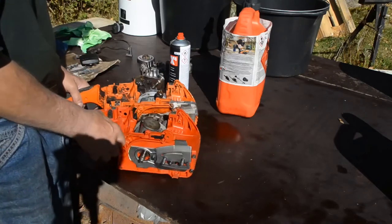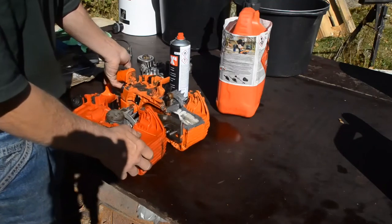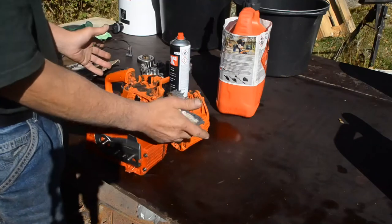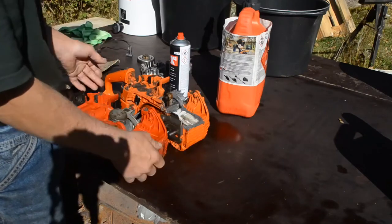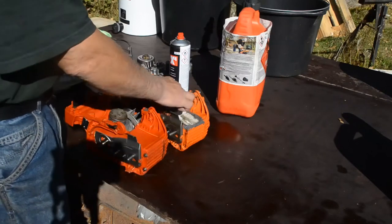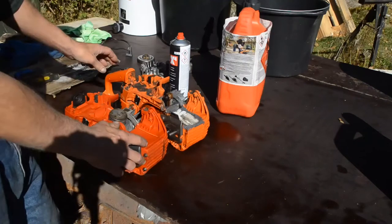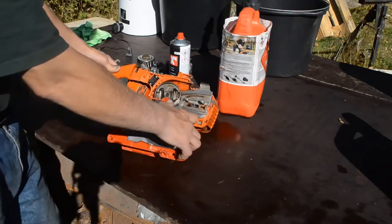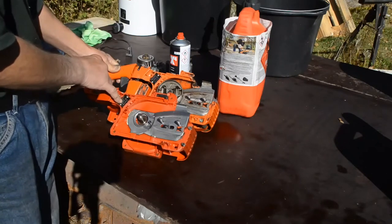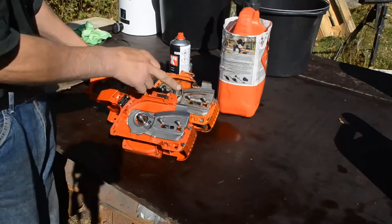So the common very bad thing on these chainsaws, if you use it and the muffler is loosening when you are in activity and you don't notice it, then you melt a big hole and you damage the whole casing. So they look very much the same. Yes, they have the same cool plate here, which tells which saw it is, but they are exactly the same.